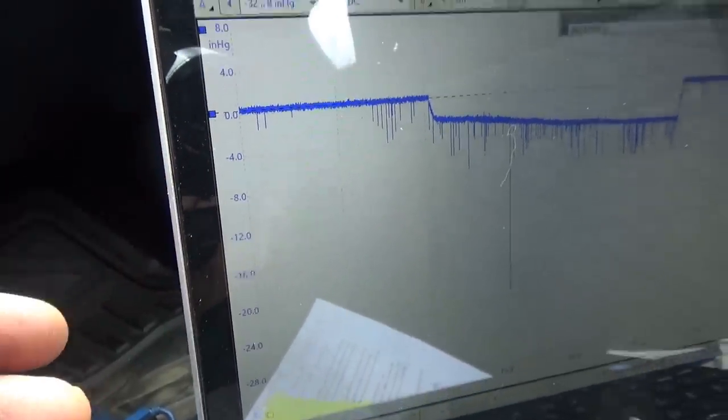So not that much. The car has a very, very light — maybe a little surge. It's hard to reproduce and the car is always accelerating, so you have to slow down and start over. We could go up the mountain, but full throttle is a pretty steep grade, so the EGR might not even be active there. We need a constant, not-too-steep grade to test this system. What I want to do now is pinch off the vacuum line and see — go up the grade here at about 45 miles an hour — and see if there's absolutely no surge.